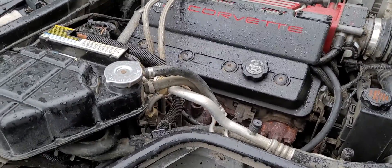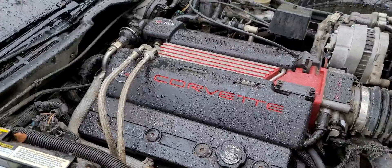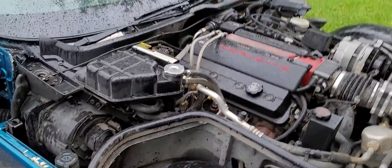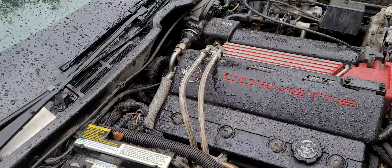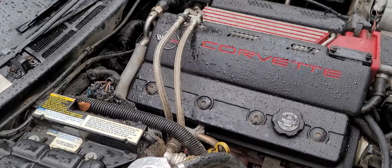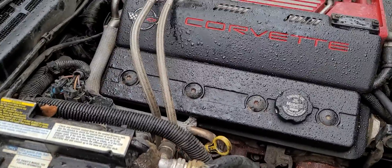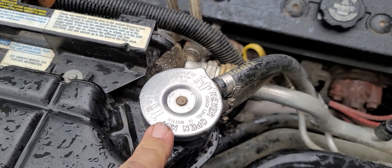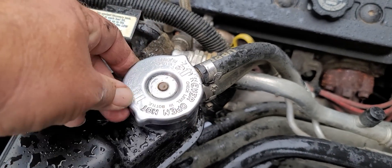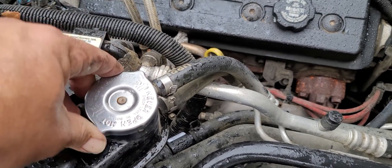One thing I'm going to end up doing on this car is replacing all the hoses, because they've never been changed and are about 25 years old at this point. Other than that it runs really well - the thing still runs like a scalded ape down the highway - but we'll freshen it up so we don't have any problems, especially with the AC on in summer. Also, that crossover tube in the back - most people don't even know it exists, and it will leak from back there too. There are a lot of potential problem areas. The cap also gets overlooked: don't put too high a pressure cap on here, because if the system pressure is too high you're going to blow hoses and damage the system.